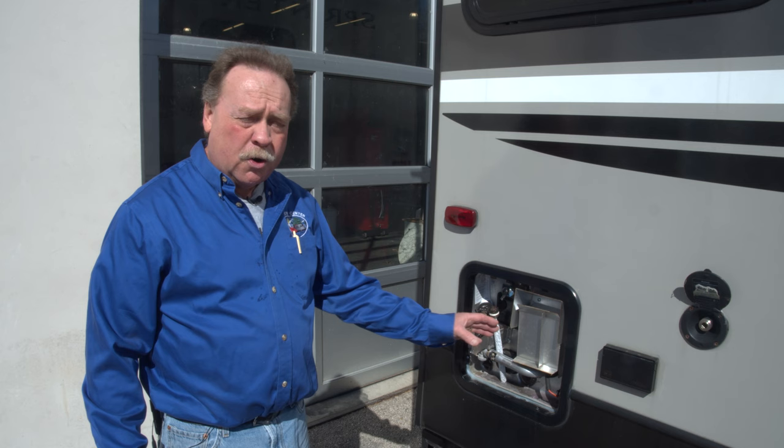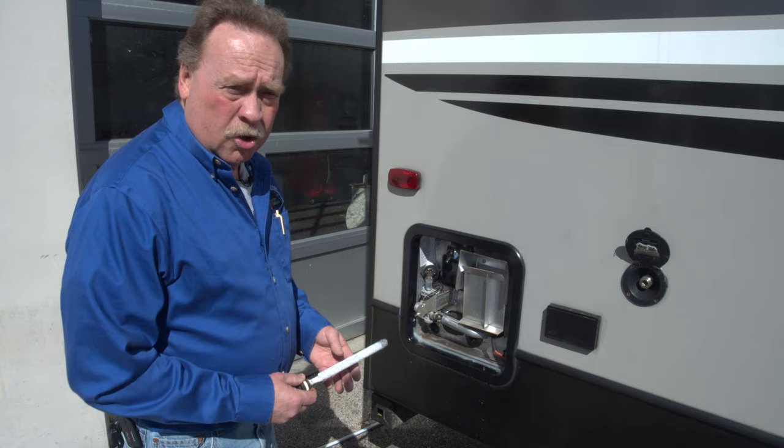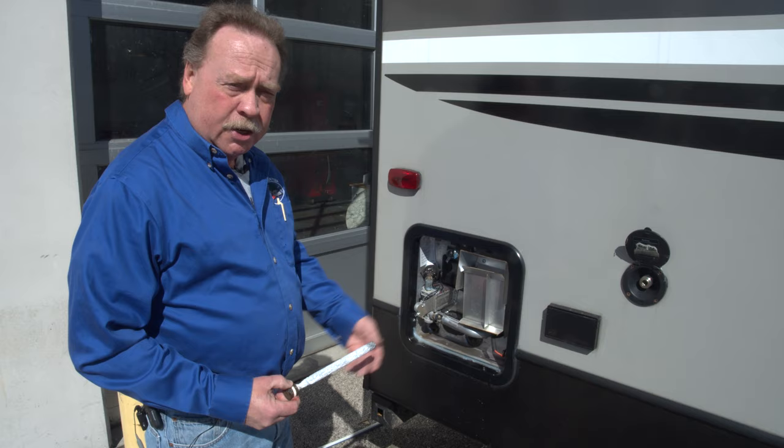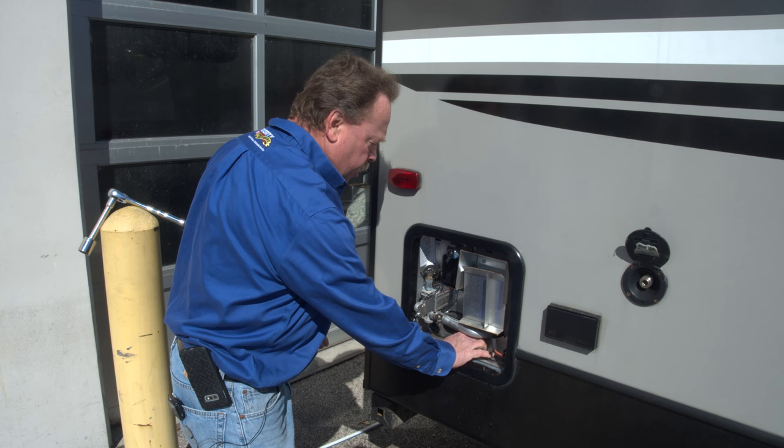Once we're done on the inside we're going to move on to our water heater and take it out of its winterized position. I'm going to turn it on inside and let some water run through it just to flush any sediment that has accumulated over the winter, because we always leave our plugs out of it. I'll let that run for about a minute to flush debris out of the tank. Then I'll turn off the cold water inside and come back out to put in our plug.